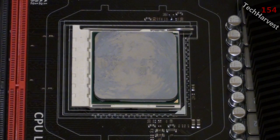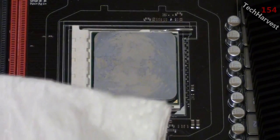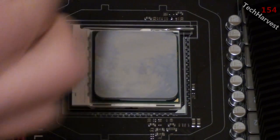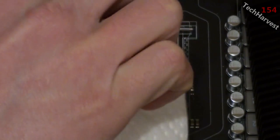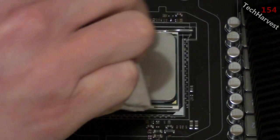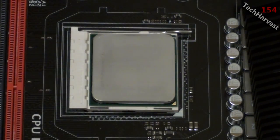As you can see, there is some thermal paste smeared onto the CPU. The first thing I'm going to do is clean the majority of that off, so I'm going to grab my paper towel and just rub the thermal paste off the CPU to get the bulk of it off. As you can see it starts to come off — and as the name implies, it's got a paste consistency to it. It's silver. There we go — I've rubbed the majority of it off onto the paper towel.